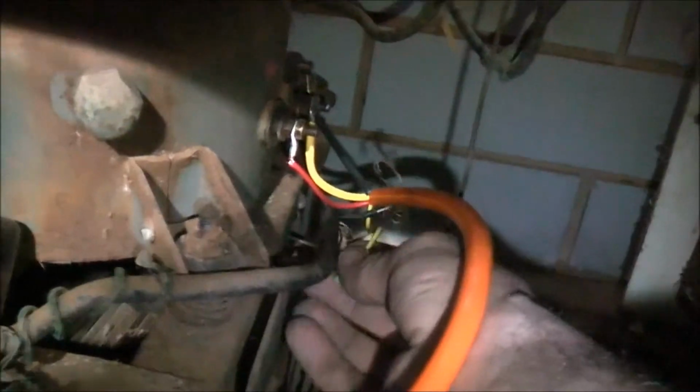Viewers, I've got some more wiring done on this fridge. I've done the compressor side of it. The compressor's been rewired, properly colour coded and everything. I'm going to make a new lug for the earth. It's going to go probably on the bolt here, with another earth lug probably on here. Loosen this nut and put a big lug on there for the earth.